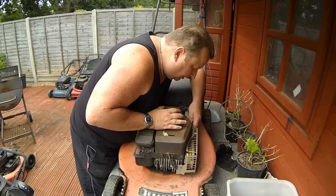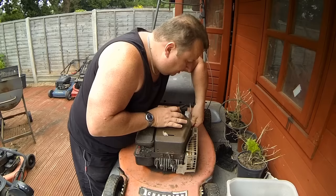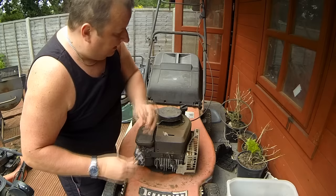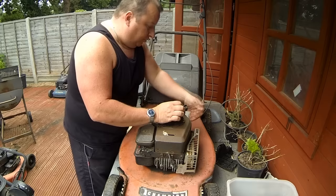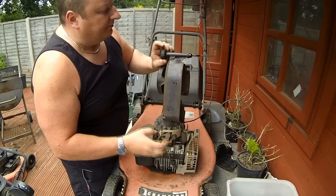I know it's not great engineering practice to cross between imperial and metric, but there's no real torque settings involved here - just tighten it up. To get the cover off it's just the 3/8 or 10 mil bolts. On the back of ours we've also got this oil dipstick with a dipping tube that pulls out from the crankcase, which will leave your crankcase open.